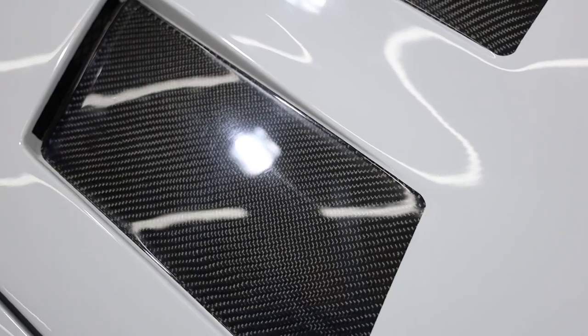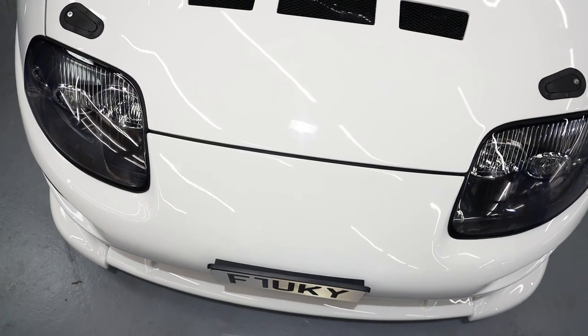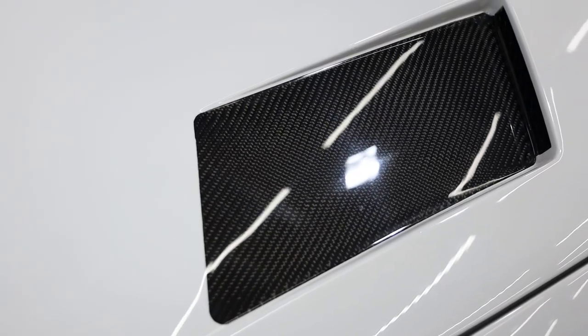But let's stop the car. And now you can see on the straight edge, it's all the regular patterns, which we can rectify, we can fix that. But if you were to look at that with a round torch only or sunlight, it's got what we call a flat light, a diffuse light, is helping us see a completely different type of defect.